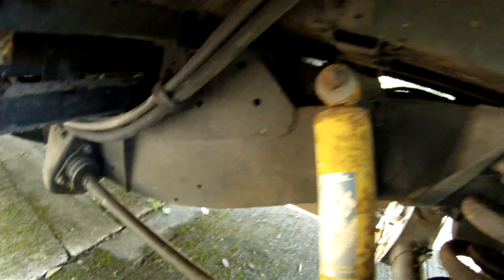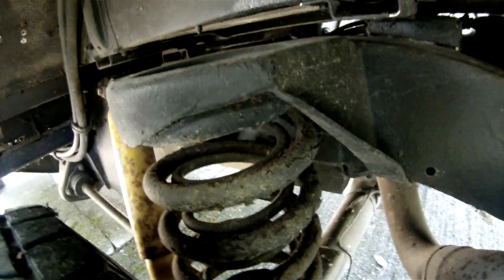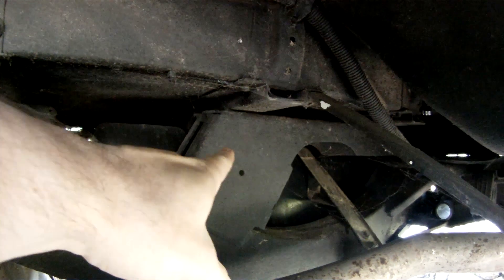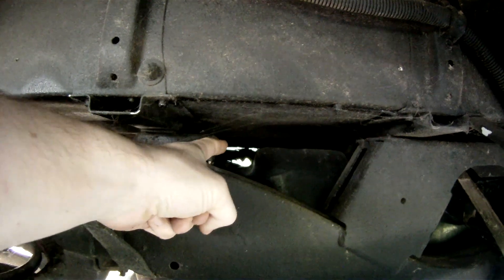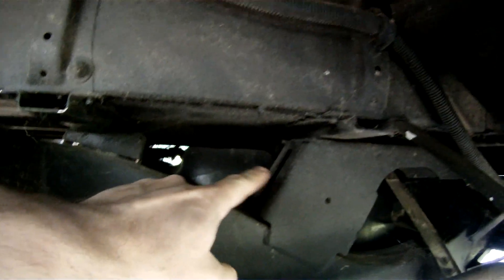Underneath, this is all the cabling and piping for the rear air conditioning, which is this unit right here. It's fairly standard under here. It's had the OME - Old Man Emu - shocks put on. This has always got 130 helper springs in here; these look a bit tatty so I imagine these are OME springs as well. There is the stainless exhaust, not looking so stainless anymore. One of the big features of a ROW spec Defender is the plastic fuel tank, which is the same as the TD5, although it's got a different sender - only two pipes into the sender as opposed to four on a TD5, because this is essentially just a sender unit and a fuel pickup, not a pump.